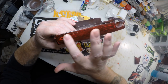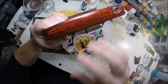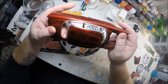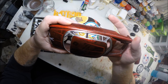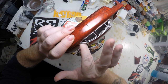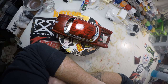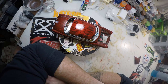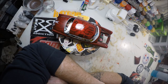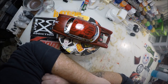So what I'm going to do is start cutting it back — just wet sanding to get it cut back and real smooth. We'll have to be careful not to cut through the clear coat, but as long as I don't go too crazy with it I should be okay, since it's got four coats on it. I'm going to do a video series on that as well. I've been getting quite a few questions about how I do this or how I do that, so I think I'm just going to do a whole new video series on it — go step by step — and I'm going to use this body and this paint job as a template for that.